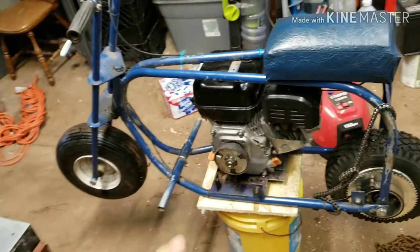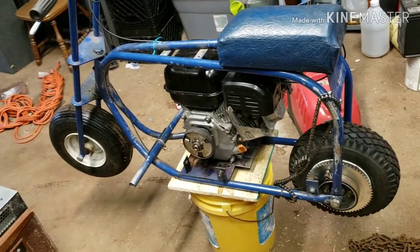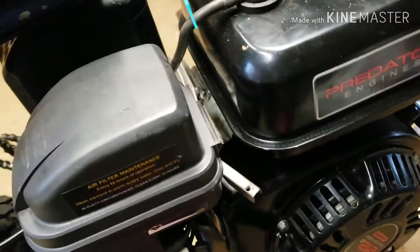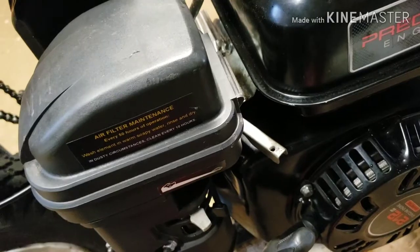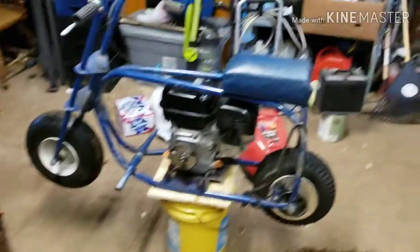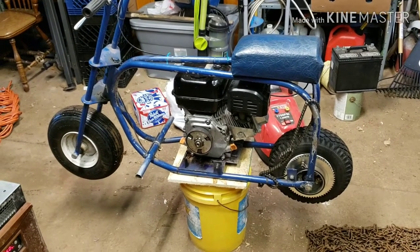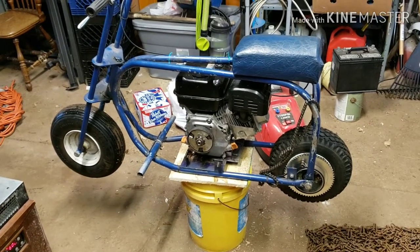This thing's got a lot of torque down low. I didn't go fast — one, because it's raining, and two, because it's just kind of a shakedown run. I might actually add another return spring on the throttle, because if I go wide open and let go, it kind of doesn't want to return all the way every now and then. I'll do that on my own time — probably won't video it, it's something most of you could probably figure out on your own.